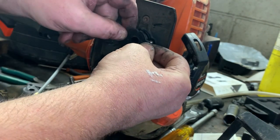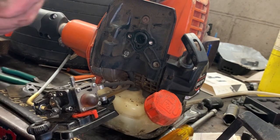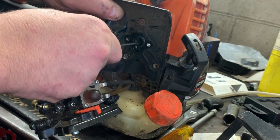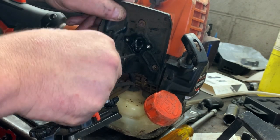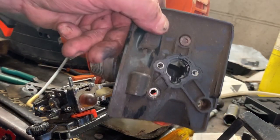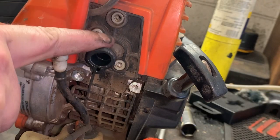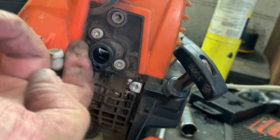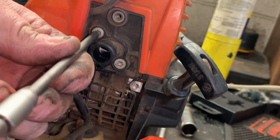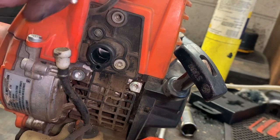Go ahead and pull your carburetor adapter out of the intake boot. And then you're going to take a blunt pocket screwdriver, and we're going to push the boot inwards. So, and then we'll remove the intake block. So basically, I'm this far in. All I want to do is inspect my boot, make sure it's not ripped or torn. But I have to take this off right here because I want to apply a little Loctite to these mounting screws here.